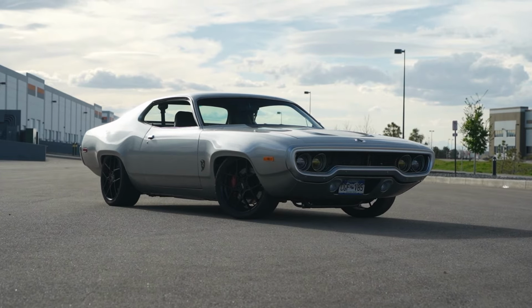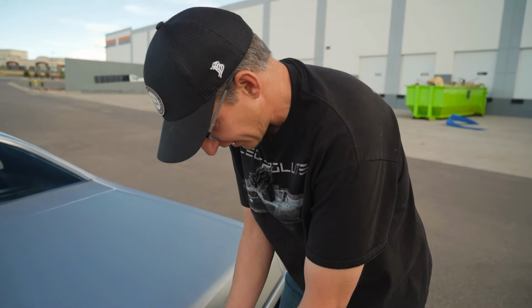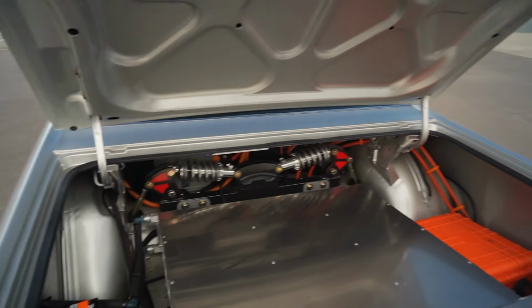And what tires are you running? These are the Nitto 555 G2 street tires. Nice. It mounted under the car almost like it was built for it. Four bolts, and it just drops out of the car. That's amazing. There was one problem with mounting the whole subframe underneath. I couldn't fit springs underneath the car, so I had to go to a cantilever setup in the trunk.